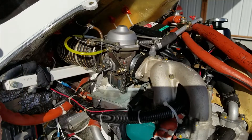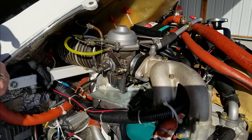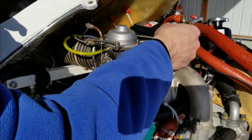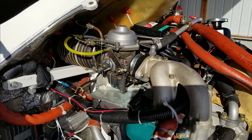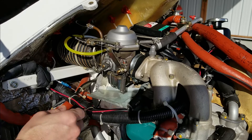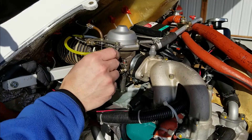So to this point, we've covered removing the carburetor to gain access, removing the bowl, inspecting the bowl, inspecting the floats, and reinstalling things. We've put our vibration dampening spring back in place, so we're right back to where we started. The last thing I'll cover is balancing the carbs. There are two means to balance the carburetors: a pneumatic balance requiring the engine to be running using vacuum gauges in the cross tube between the manifolds, and a simple mechanical balance — which I find is all these require from time to time, maybe every six months.